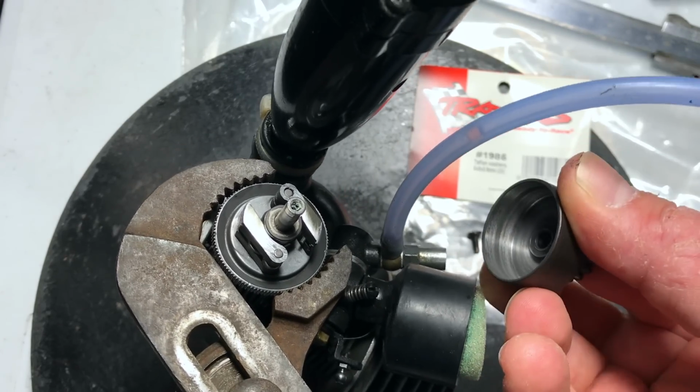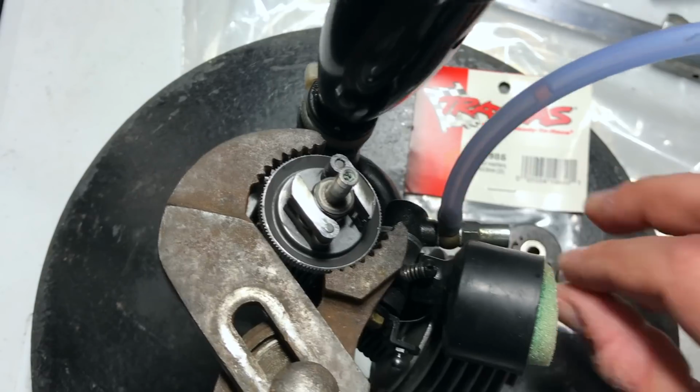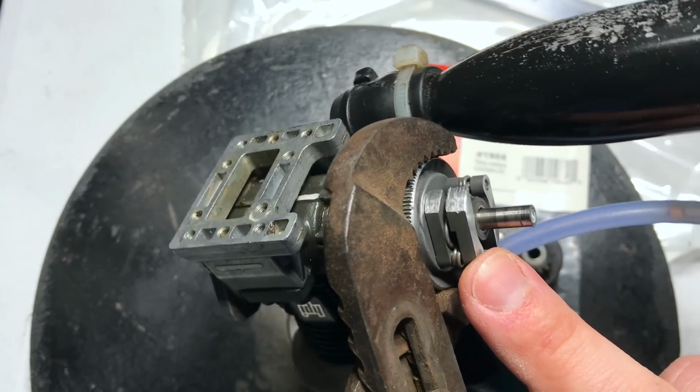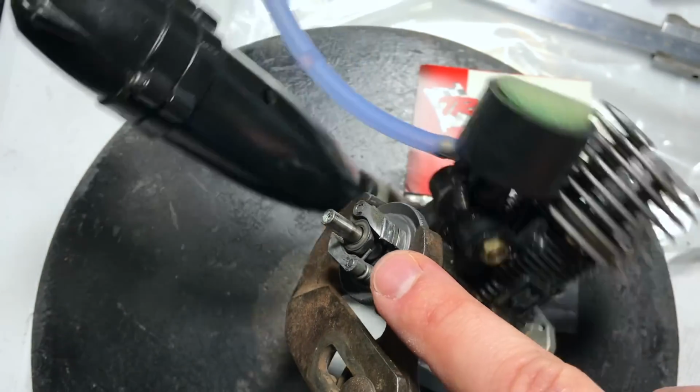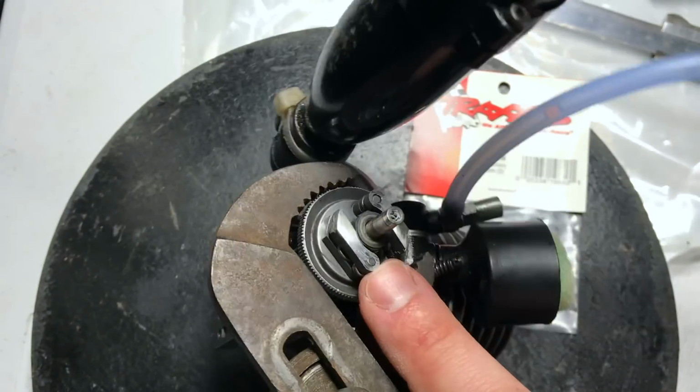Inside of the clutch bell is good. I see very, very minimal wear. Bearings are okay. The clutch in this thing is actually a 2-shoe aluminum clutch. Man, the HPI G 3.0 surprised me yet again. Nice setup over here.